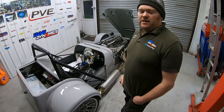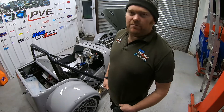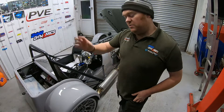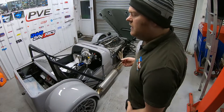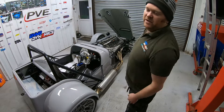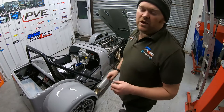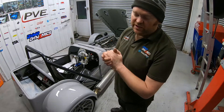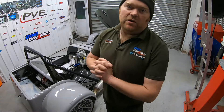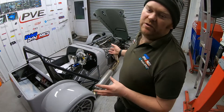Originally he just wanted it running and had various ideas about how to make it run. After a quick chat, what we did is put it on a Max ECU Race - we love those here. It's the H2O version. We wired the whole car front to back, literally between the front and back number plates. The Max ECU Race will run both the Vanos units. We're using the original coils and original injectors at this point. The engine is a little bit tuned - it's got various goodies and a set of camshafts in there.